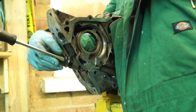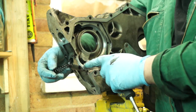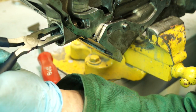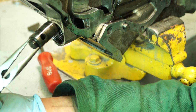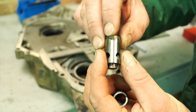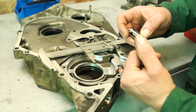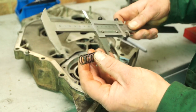The spring is in here and the plunger is inside the bore — we need to reach in, grab it and pull it out. Unless you've got sucker fingers, you'd want to use a pair of needle-nose pliers which are perfect for the job. We have the plunger — note which way it's fitted. Once the plunger has been cleaned up along with the spring, check the condition. Where it's slightly shiny indicates wear — if it's shiny all down one side you know it's pretty well worn. Use your finger to feel for any lips on the inside of the bore where it lives.